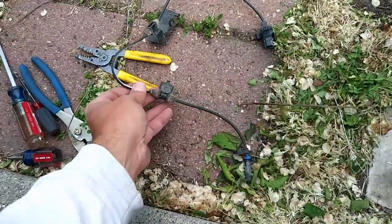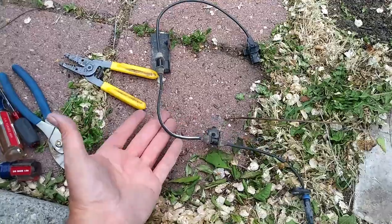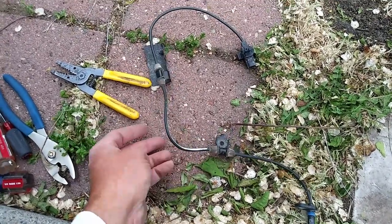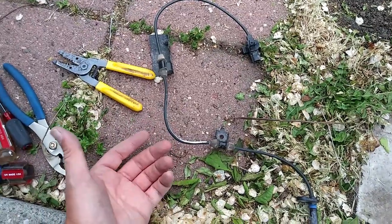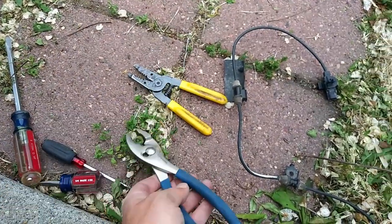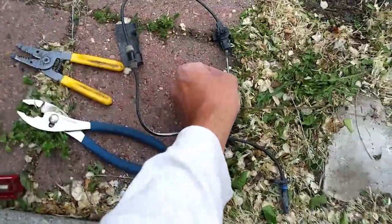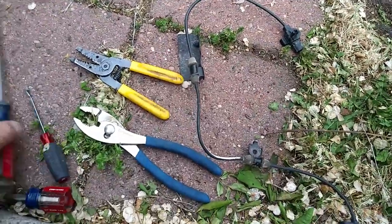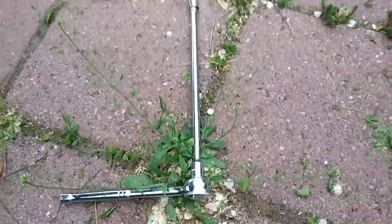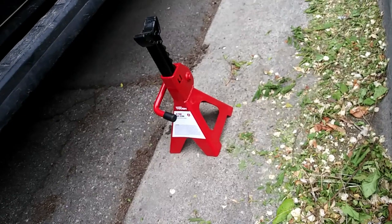Now here are just the tools I needed to replace it. That is the right rear vehicle speed sensor — I had to order this from Honda. My local dealership actually had it at a pretty good price compared to an online place, and I liked being able to return it if it wasn't the problem. It was 60 bucks. I used a pair of pliers to pull the thing out when it was a little stuck in the hub, a screwdriver to pry that little orange plastic clip to free the connector, and then a 10-millimeter socket on a 12-inch extension on a ratchet. That was it. There's the jack stand — I bought it at Walmart for 10 bucks.